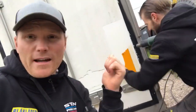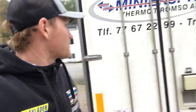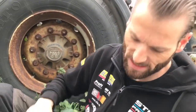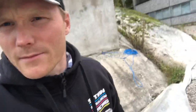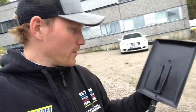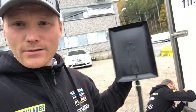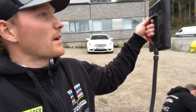This is the container you guys know — it was on top of the trailer. On the sides I'm going to cover it with roof panels so it looks nice. But on the rear, on the doors, I'm not going to cover it — I'm going to paint it. So we are removing the stickers now. Many of you guys probably know it, but the heat gun works really well to remove stickers. But what works better is this steam remover — it heats up the water so steam comes out, heating up a much larger surface than the heat gun. And when you remove all stickers there's always a lot of glue left. After you remove that, you have to use C2 solvent — spray it on, leave it there for a few minutes so it's working with the old sticker glue, then scratch it off.